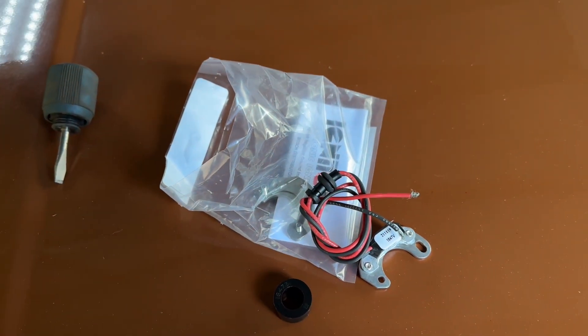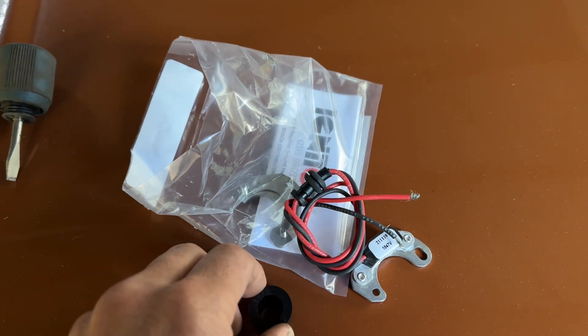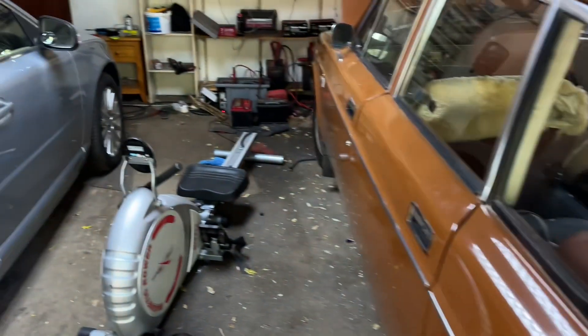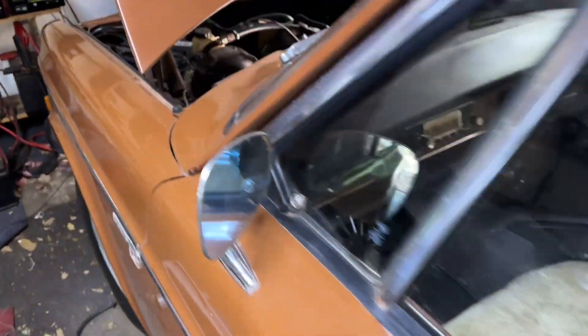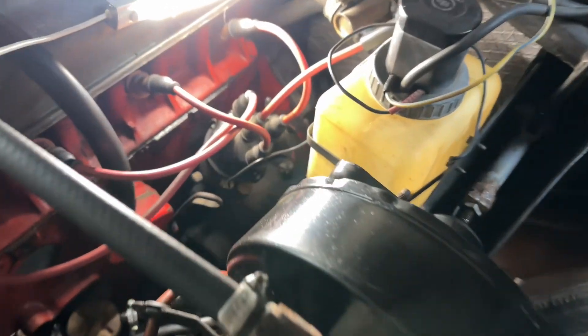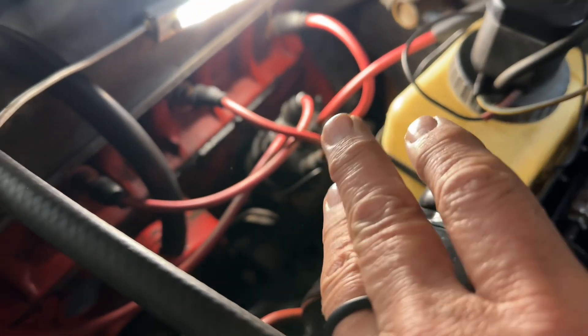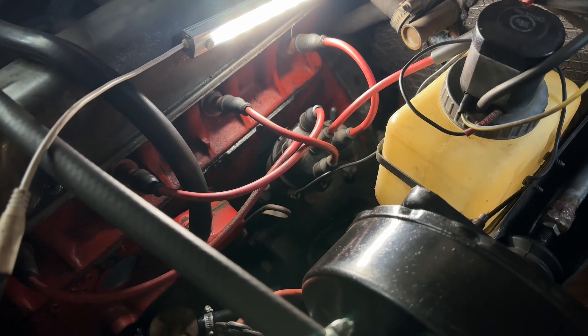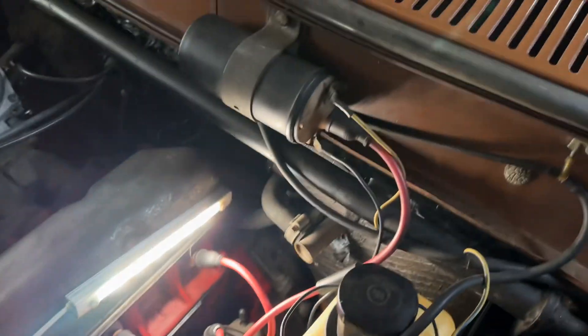The really nice thing is that you can put your points in the cubby. If this ever fails, you just unscrew it and plug the points back in. It's a job I'm going to tackle today - very simple in theory. Simply pull off the distributor cap, unscrew the points, replace it with the electronic unit, and connect it to the coil.